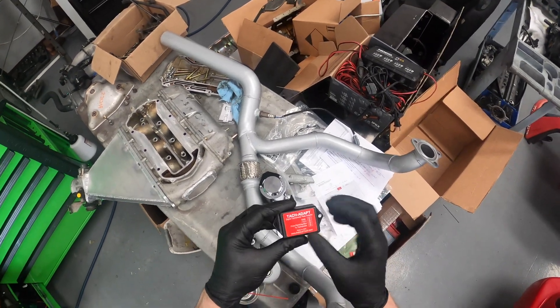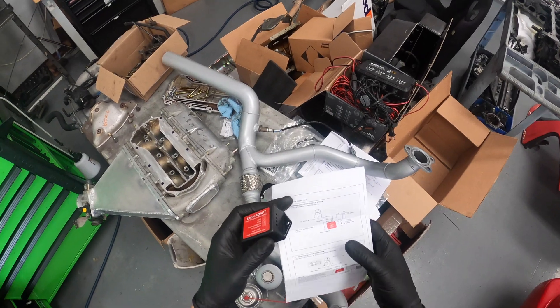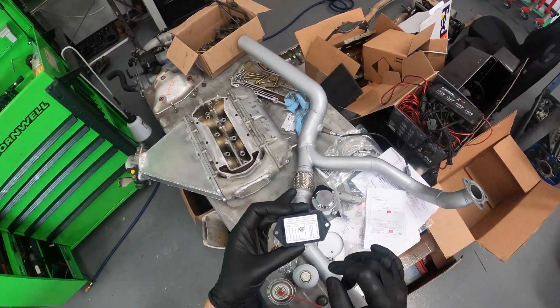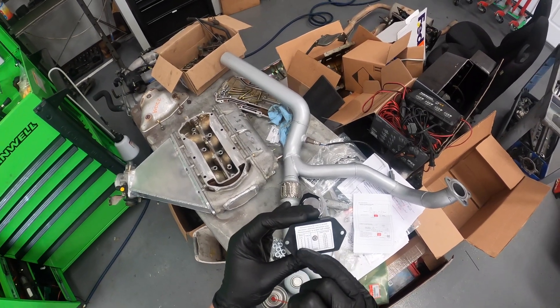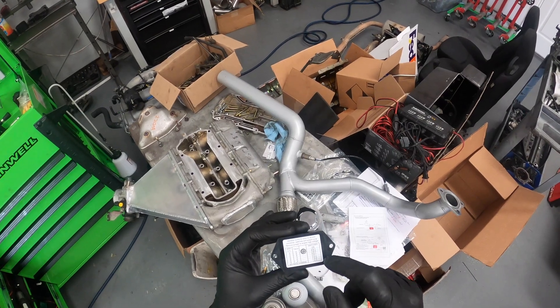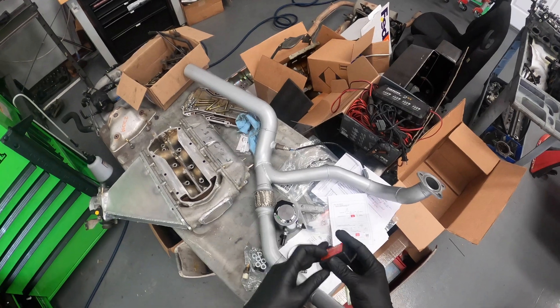The customer also delivered an Ashlock tachometer adapter. We'll be using the traditional ignition system. We opened it up and converted it from a six-cylinder to a four-cylinder tach signal by flipping dip switches two and seven. Pretty nifty little unit — we'll wire it up next.